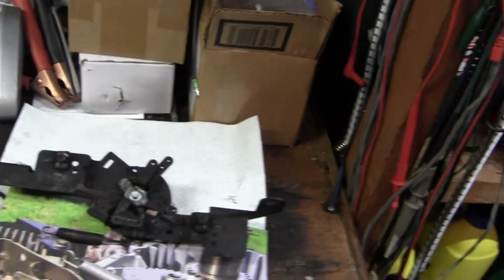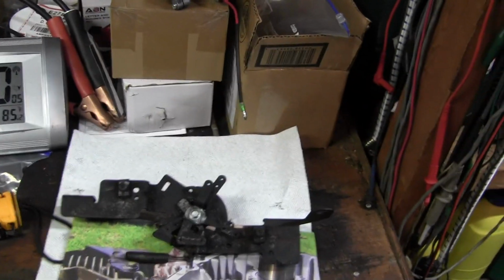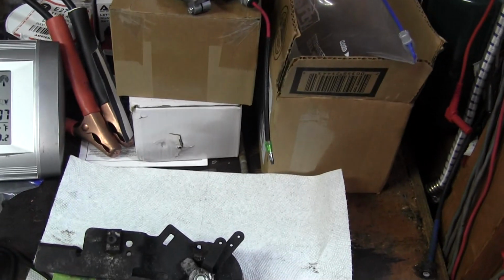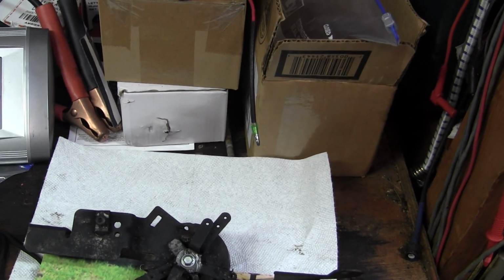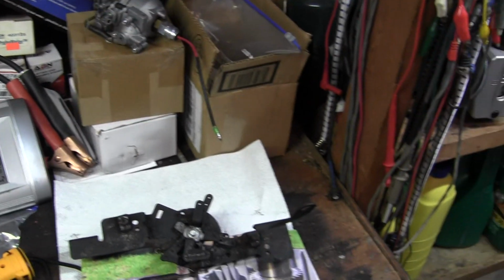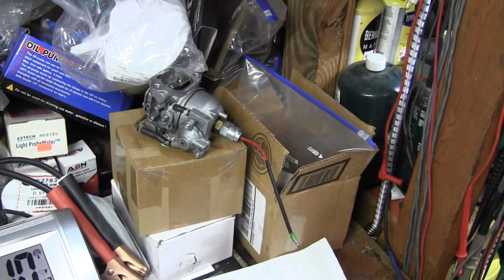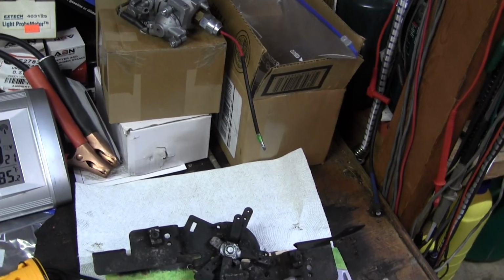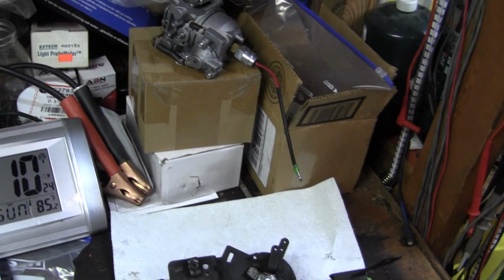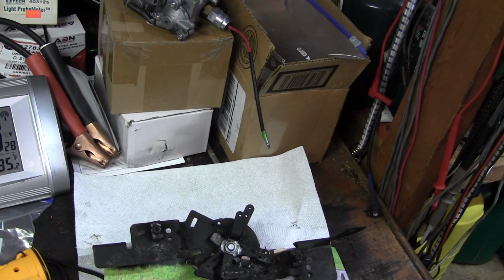The biggest problem on this engine, biggest, is Sears or somebody put an easy oil change, and that thing always failed. So if you got it, get rid of it on this engine. You can either block it off with a plug, or on mine I put a better way to change the oil, and we'll get into that later on future videos, what I did with my engine.